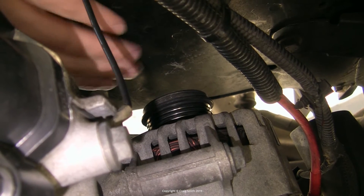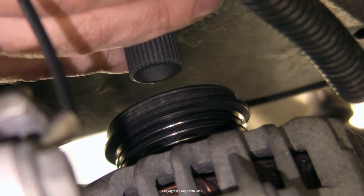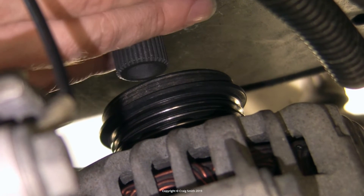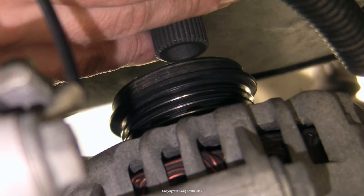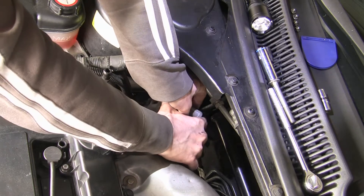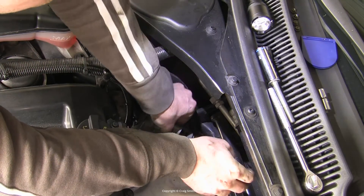Which leads me to access in the car. As you can see there's basically no room at all. The tool is the correct spline insert with a 17mm hex — there's no way to even get it inserted, much less work it. And even if I could, I'd still need the second tool to hold the shaft using the small hex. Hand tools wouldn't suit me in this case anyway. The long and short of it is the alternator will probably need to come out of the car — and it certainly did in my case.